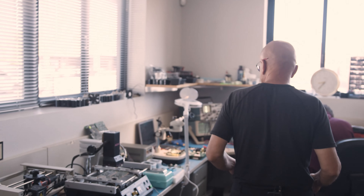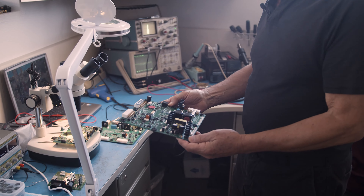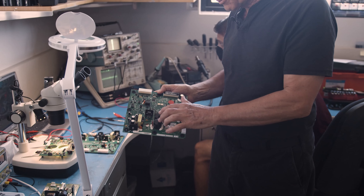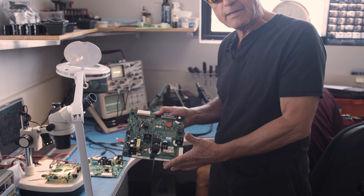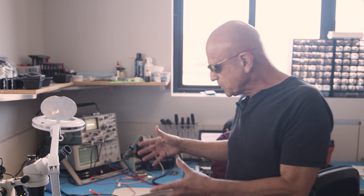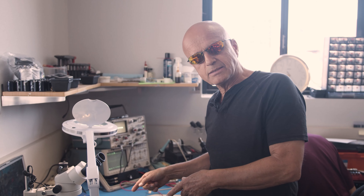The second electronic assembly very deep inside the Tesla Roadster ESS main battery pack is the BSM board, which is also a highly custom board designed specifically for the Tesla Roadster — it is not an off-the-shelf product. This BSM board also has aging components that need to be replaced. You can see a number of electrolytic capacitors on this board, and we have a couple of relays, which are mechanical devices that also wear with time. To recreate something like this in the quantities needed for a spare parts program is just not cost effective, so the only option is to rebuild, repair, and maintain these products.